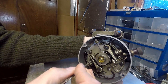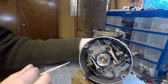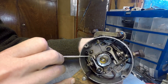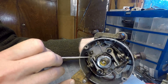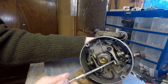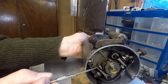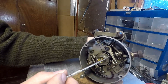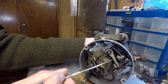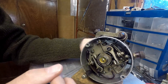What this mechanism is meant to do is provide a double trigger for the ignition event. When the first set of points opens, that gives you the beginning of the trigger event. The points are open there, but these points aren't open yet because this hasn't got to the lobe. When this comes up to the lobe, then that triggers the spark.